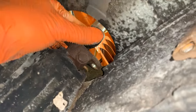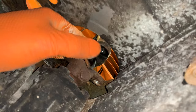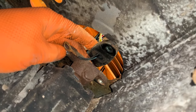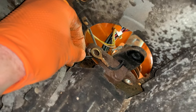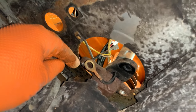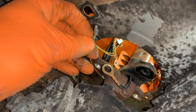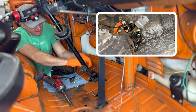Here underneath is what things are looking like before we put our coupler back in. This ground wire goes through the actual steering shaft and through the coupler, then grounds on the other side over here. We'll clean off the area for the ground so the connection is made there. And then we have this wire, which we're going to connect to the base of the steering column. Basically, when you hit your horn button it connects the ground path for the horn right here and makes it go off. We crimped this wire down a little tighter and we'll wrap it up nice and clean off our ground points.